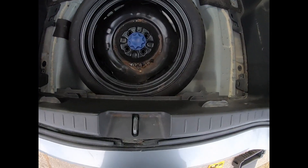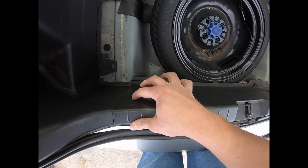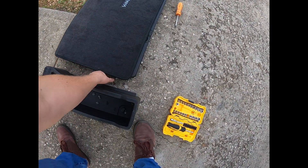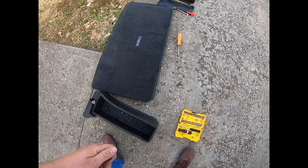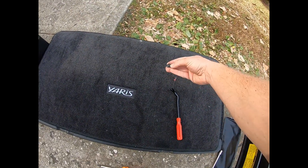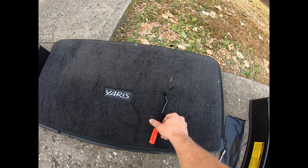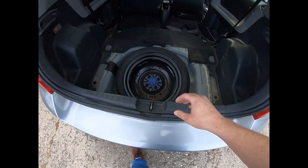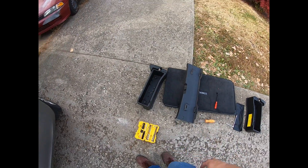After that, this piece here will be sitting right on there, and you should have two plastic clips — one here and one right over here. These will look like this if they're still in the factory form. All you'll want to do is get your clip remover tool, position it to get in between the clip and the panel, and pry out — the clip will come right out. If you do break those, don't worry, they're not expensive; probably a couple of dollars at your local parts store.